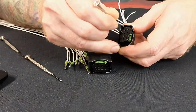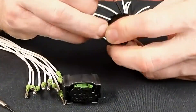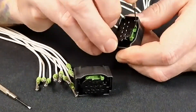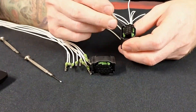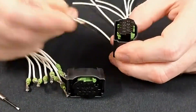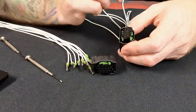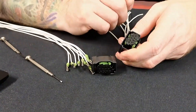It's pretty easy — you just slide the screwdriver down in there. Let me look at what I'm doing here. I'll try going towards myself — it won't go. Try it the other way and it goes right away. So you'll know immediately if you're going the correct direction. There is a tiny little catch on the inside on the green part that you can look at, but the bigger thing is just lightly press it down and move one direction — if it pops and unlocks, you're good to go.